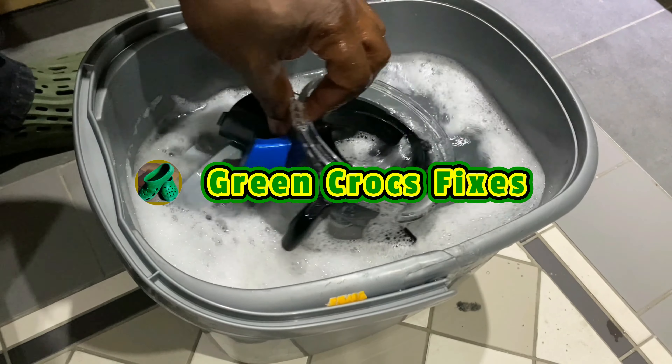So we go back to the motor head — we've also cleaned the brushes. Nice and clean and clear now. Just show you the actual motor head itself, give that a clean also — it's nice and clean inside here, it was full of dust before. I've cleaned the hose up also. So it's just a matter of pushing the brush back into its housing — just push it straight in. Then it's just a matter of using a coin to lock it back in place. That's in — see there, it's locked in.